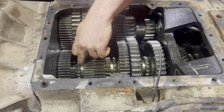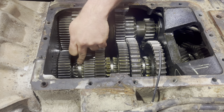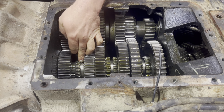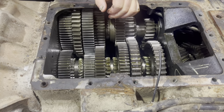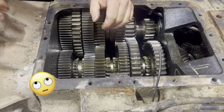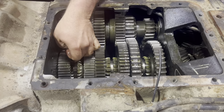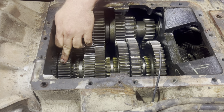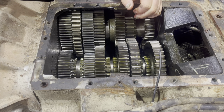What you're affecting are these three sliding clutches here with the gear that it runs with. You can see this sliding clutch was worn out — has a lot of wear on it. And if you put it into gear as it should be and you've got to move it, it jumps out of gear. So essentially you've effectively worn out this gear by not having your clutch adjusted properly, and you keep hearing this sound over and over again, tearing up the inside of these gears, wearing them out, wearing out the sliding clutches that run with them.